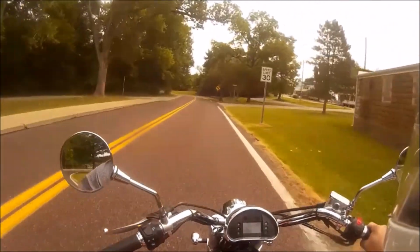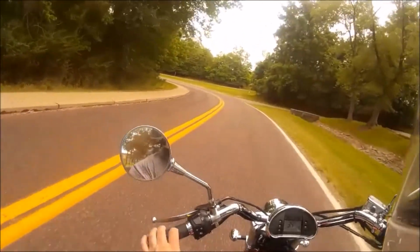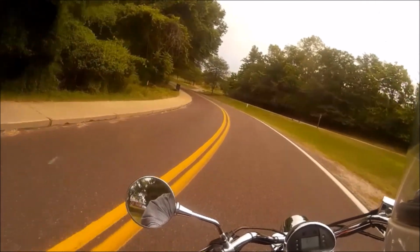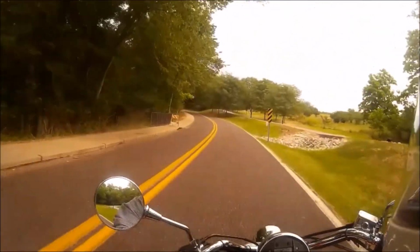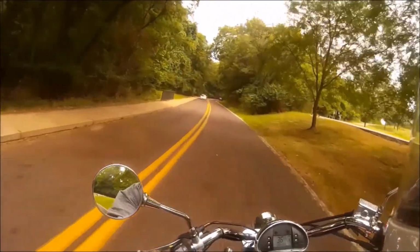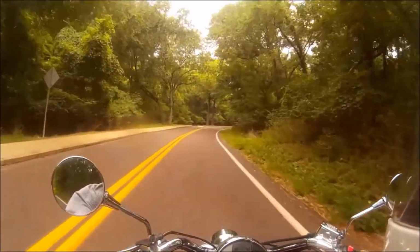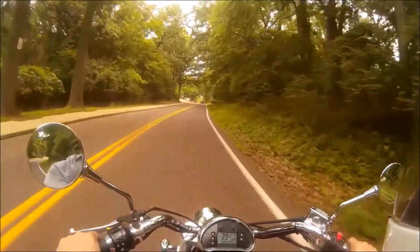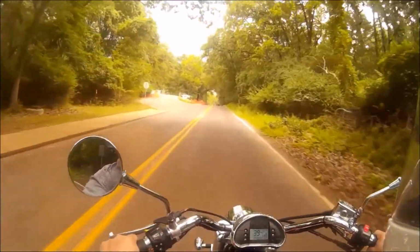You kind of know when you get one of these bikes that you might have to do this upgrade. And this bike has an EX250 stator in it, and it also has a 2013 Yamaha R1 MOSFET regulator in it. I didn't reinvent the wheel here, I just followed what everybody else did and wired it in, and it's been really nice. It just makes the whole bike run a lot better when you've got good clean voltage running to it.